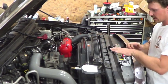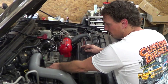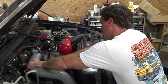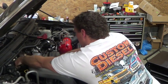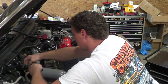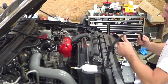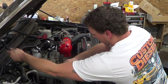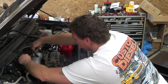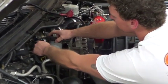Now we're going to install our other coolant line, which is going to go right in here where your heater line comes out of the water pump and goes back to feed the heater core. We've got our clamp removed and we're going to slip this hose off. We're going to route it around behind the oil fill neck and tie into this hose, so we need to make a cut about right here to install our tee.